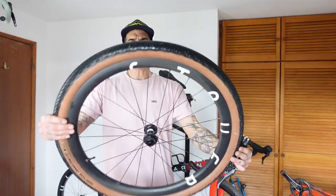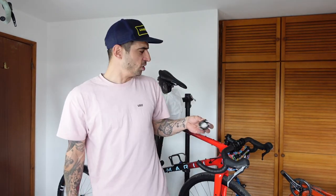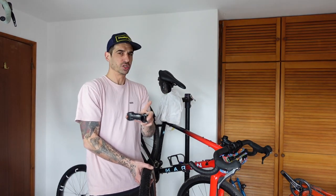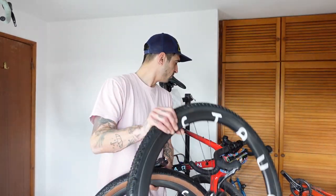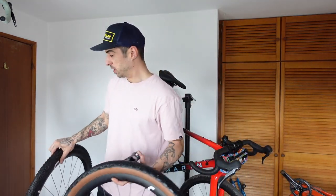The wheels are all cleaned. I need to get these old ones off and put the discs on. I'll be using the wide range E13 cassette on the rear. I did order a 100mm stem but it hasn't turned up yet, so I have a 90mm and a 110mm — I think I'm going to put the 90 on, which is about two centimetres longer than the current 70mm stem. I also want to change the saddle, put on new bar tape, and slap these wheels on my other frame — so I'll have a 700c and a 650 setup.